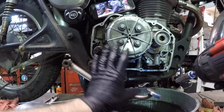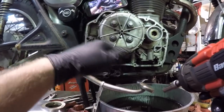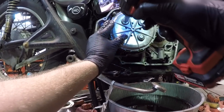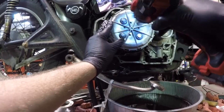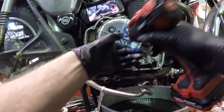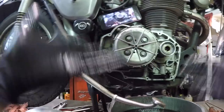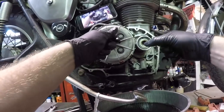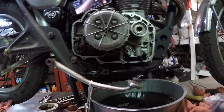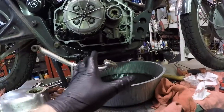So I'm just gonna, again, same order of how you took it off. You're just gonna go on one at a time. Don't button one all the way in and the other one and start going around like that. It's just in a star pattern or X pattern. Tighten. Tighten. And for my bike, I'm just gonna do one quick hit. There, there, there, and there. It may be more, it may be two less. Okay, so just make sure that they seat. And I would give them a little quarter turn on each one, okay? The goal is not to round those things off or snap them off inside the hub, obviously. So just a nice seat, little quarter turn on each one, that should do you. So those are tight, which is good.